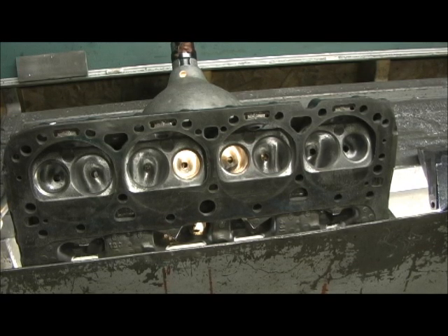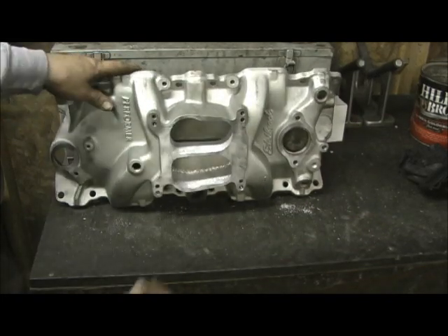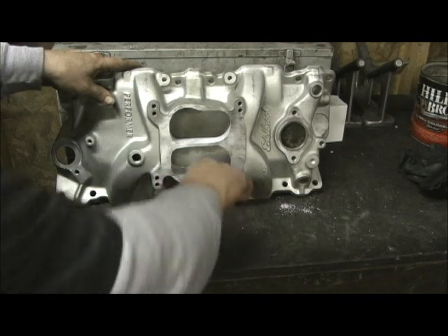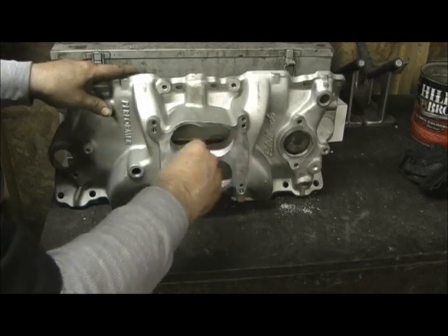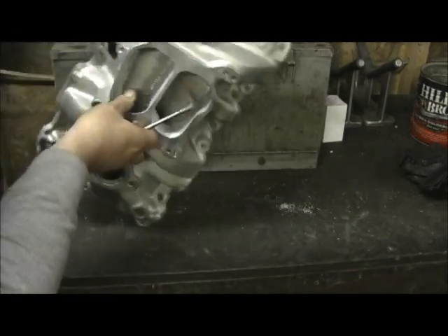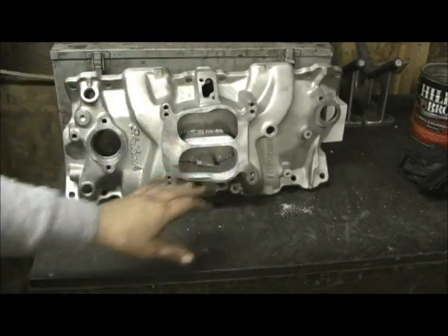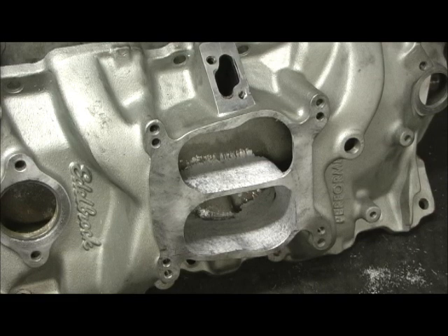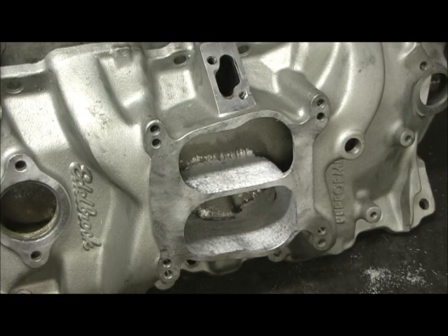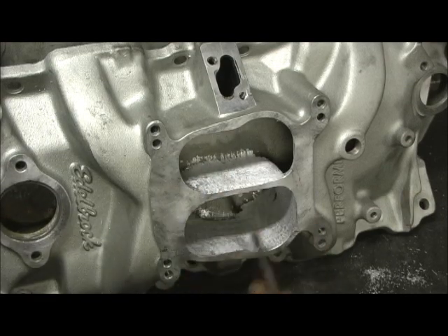Let's go ahead and get on with the project — bits and pieces — let's take a look at the manifold. The manifold is just a typical Edelbrock Performer. You can see where I went in and blended all that, radiused the runners as they go into the divider. It had a bunch of rough casting — blended that all the way to the floor. I do not go in there and polish that. If anything, that's what you want to be rough — that's where the fuel is coming right out of the carburetor.